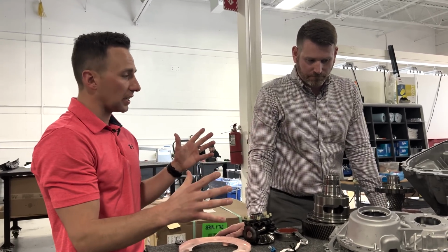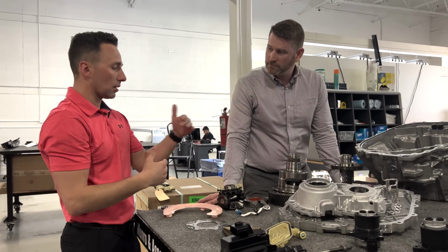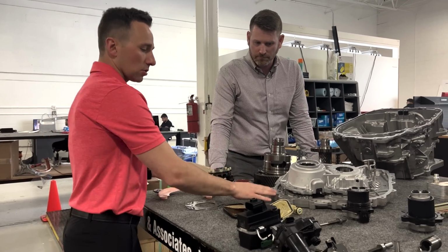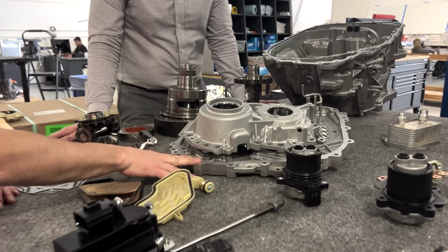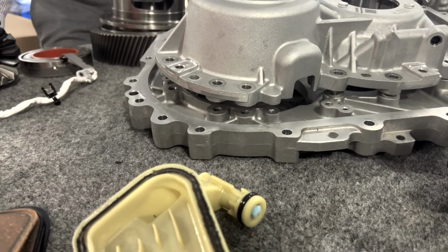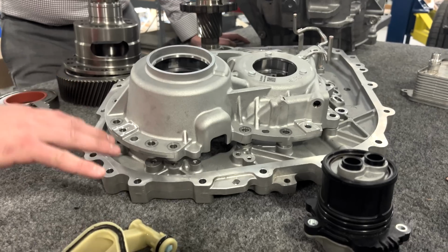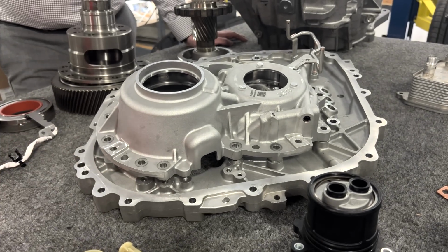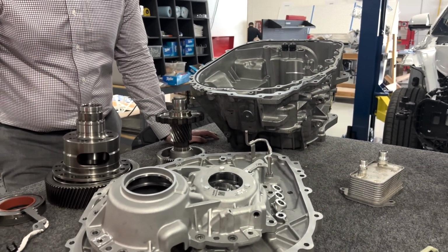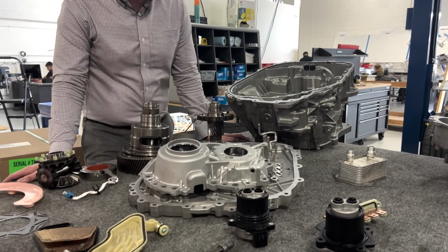The general orientation of having an offset motor, like rotor and stator and gear drive unit, is relatively conventional. But to pass through a structural medium like what we're seeing right here with this bulkhead, this is every bit of 25 millimeters, if I calibrated my eyes correctly this morning. And it is quite structural, and it's sandwiched between two equally structural and large aluminum castings on either side of it. So I agree with all your comments in terms of being robust.